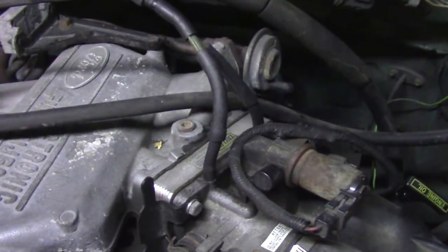Another problem with this truck: it has a throttle body spacer. No matter what they tell you, that does not do anything on a fuel-injected motor unless it's like a TBI Chevy. What a throttle body spacer or carburetor spacer does is give you more time to atomize your air and fuel. But this is a dry intake system - there's no fuel and air atomizing because the fuel goes right at the end of the intake manifold into the cylinder. So we're gonna take that off as well.